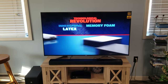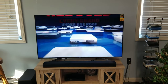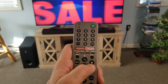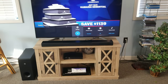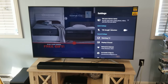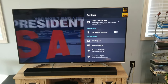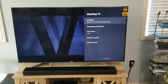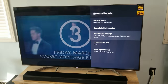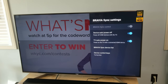If that doesn't work, then on your particular TV I'll show you how to do this on the Sony 950G series. You need to make sure your ARC circuitry is turned on in the television. I'm going to use the gear button on this Sony remote to go to settings in the TV. In this particular menu — and some Sonys have this same menu across different models — we're going to go to Watching TV, and then go down to External Inputs. This is where we want to go to our Bravia Sync settings, which is basically the HDMI CEC circuitry.